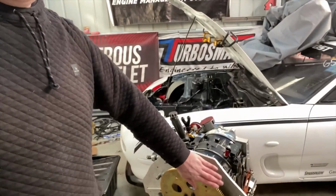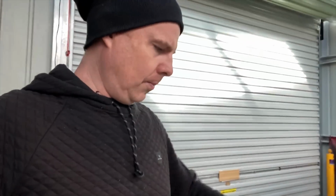So I don't know if that now opens up the door to rotary guys that want to run bolt together converters, which you'll see really popular in the States and for everyone that's Chev now, because essentially what it means is up here on the mid plate I have a Chev flex plate, a Chev bell housing, Chev starter motor. It's all Chev. So essentially from here back, it's Chev, and from there forward, it's rotary. So if you want to run a bolt together converter, you're in luck.